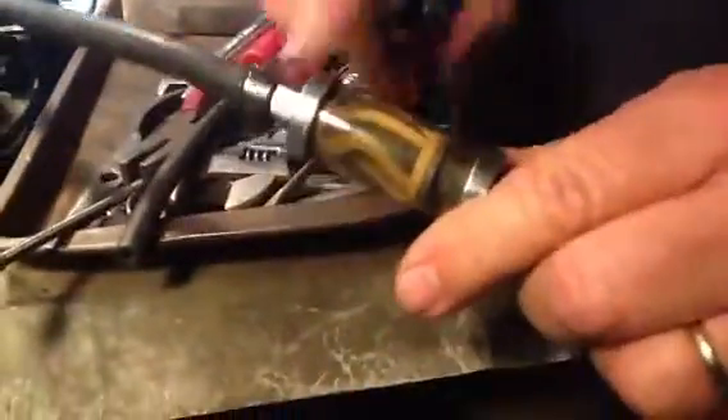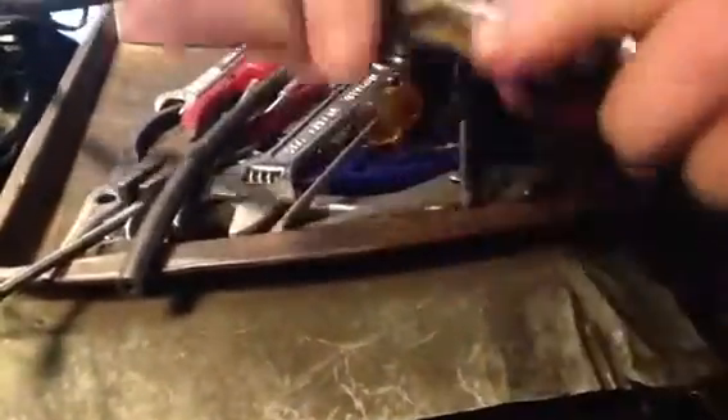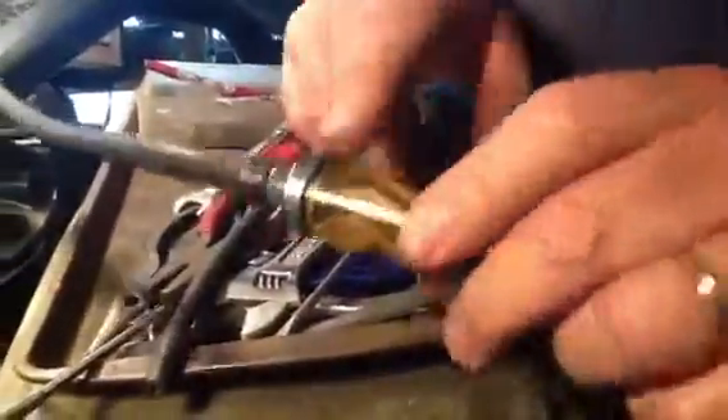This one does not have the California slow speed circuit for air. But you can see this is a good running unit. We're running our fuel pressure right here at 3 pounds. Got our little inline filter here, which you need for every carburetor that we sell. We like this kind because we can take it apart, dump the dirt out, blow it out and it's just like brand new again — you don't have to keep buying them all the time.